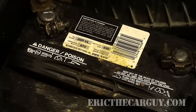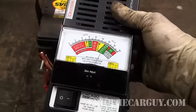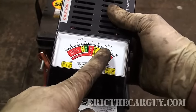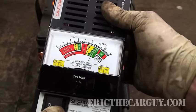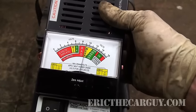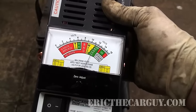But if it's above 9 volts — like I had there around 11 — and you're having a battery drain problem, you've got to look elsewhere. Here's a battery that I know is bad. I've had it charging up for a while, but even the best charge I can get is not even 12 volts, and when you hit the load — way down there. And it won't even come back up. So that's what a bad battery normally does.